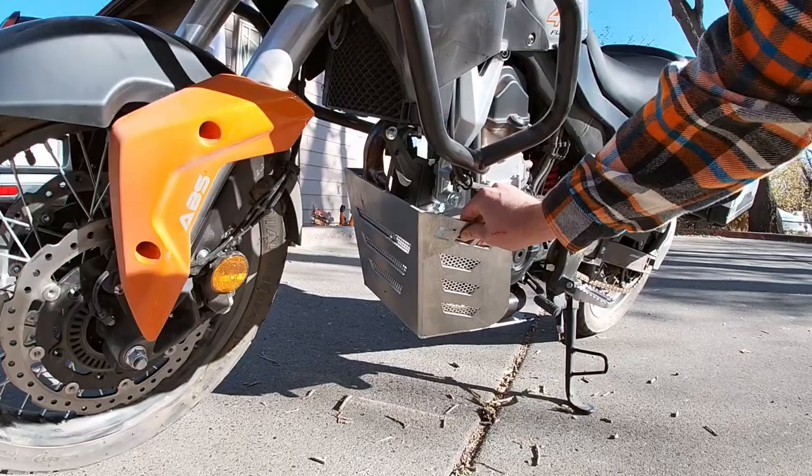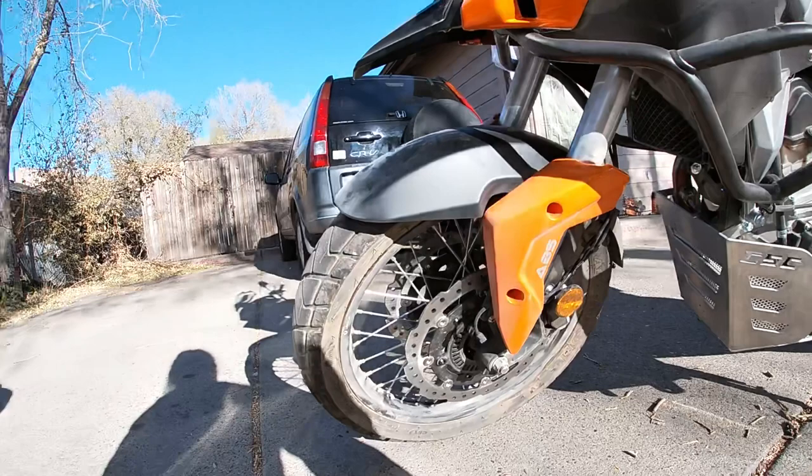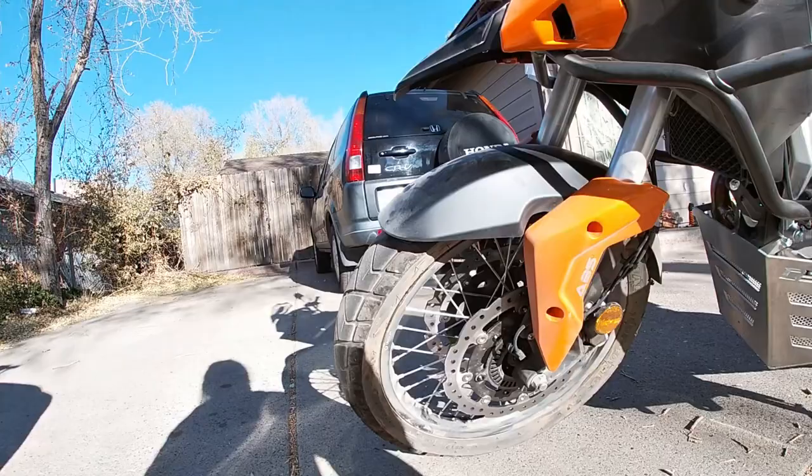Also can't forget — I added the crash guard, which has already taken a couple rock hits into it as well. I'm still also breaking in the brakes; they are not that strong as of now, but that is expected on any new disc caliper brakes. You've got to break in your brakes correctly — take them lightly at first, take them downhills a whole bunch and really feather them. That's how you break those in.